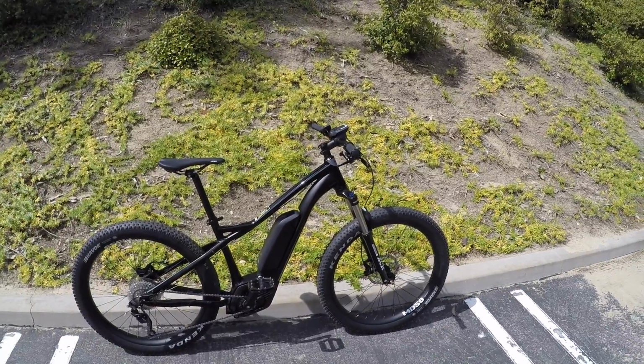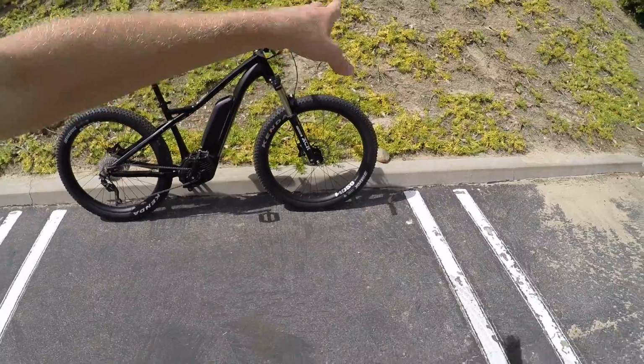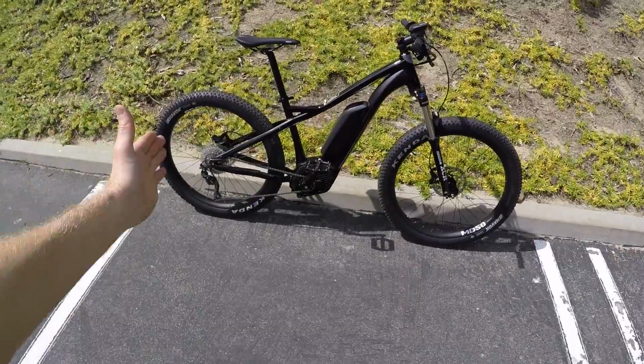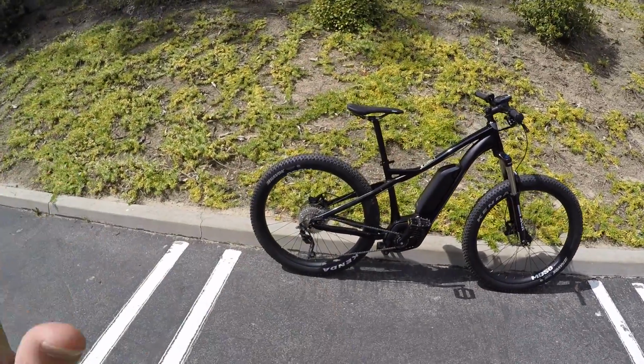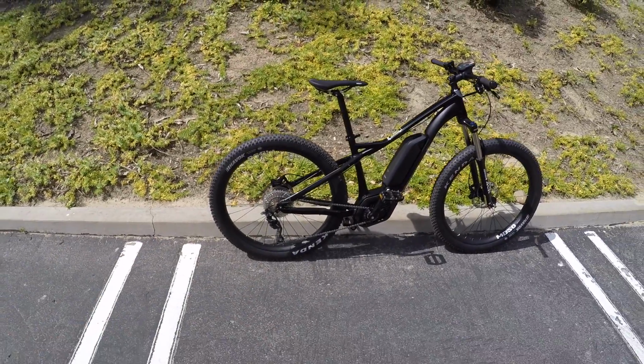There are these different tire size standards. It used to be 26-inch, and then it was 29ers, and now it's 27.5, kind of in the middle, and it gives you a little bit of that quick turning that's fun, while still giving you the momentum and the gap spanning, is how I like to describe it. A little bit wider diameter means that you can just float over cracks and bumps instead of falling into them. But you still want to be able to turn quickly, and again, bringing the frame in, making it a little bit shorter. It's just interesting. I was talking to a product manager named Kurt about this earlier, and this is just a really cool bike. For real, I'm very excited about it.